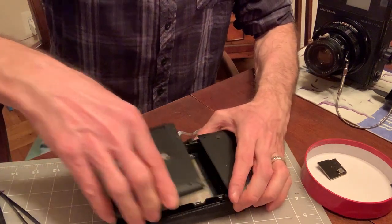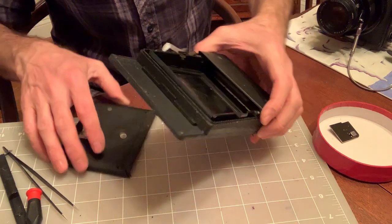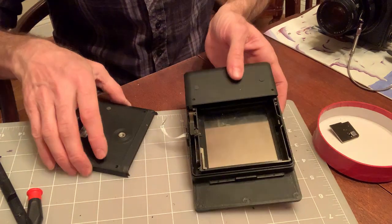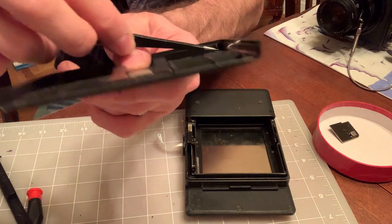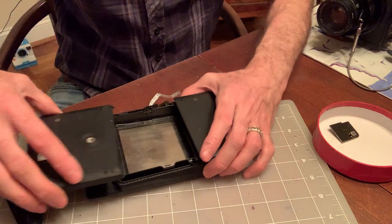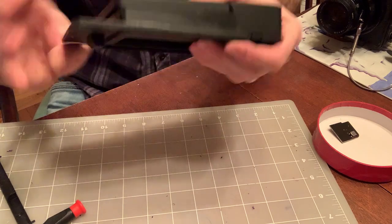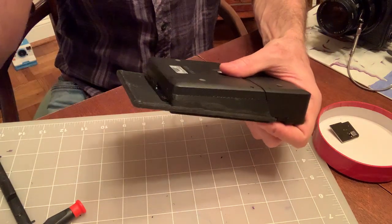Okay, so I've done this many times, but for people who haven't, there's one little trick here. So you may notice that the bottom of the inside of the lab has two plastic tabs. One here and one here. Those actually should slide in under these other little plastic tabs in the cover. And one here, one here. So you can just slide it in all the way from the back, so you kind of have to put it on like that, lay it down. There should be a few millimeters protruding out, and then push it in, and it should just go in. If it doesn't, then try again till it does it smoothly.